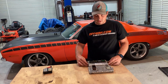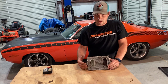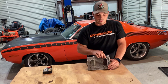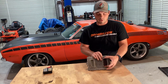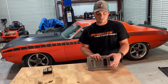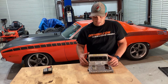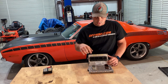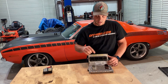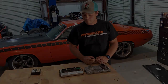Just to give a direct comparison between these two ECMs — the way we like to explain it at DIY Hemi is: your gray on the GPEC 2 is going to be your body-side functions, your interface with the vehicle itself. Your other connector, if it's a 2011 through 2014, will be brown — or maroon — and this is your engine control; all your sensors and functions on your engine are controlled through this connector. The direct correlation with the older NGC ECM is your connectors one and three are the same as gray, and two and four have the same function as C2 on the newer ECM.